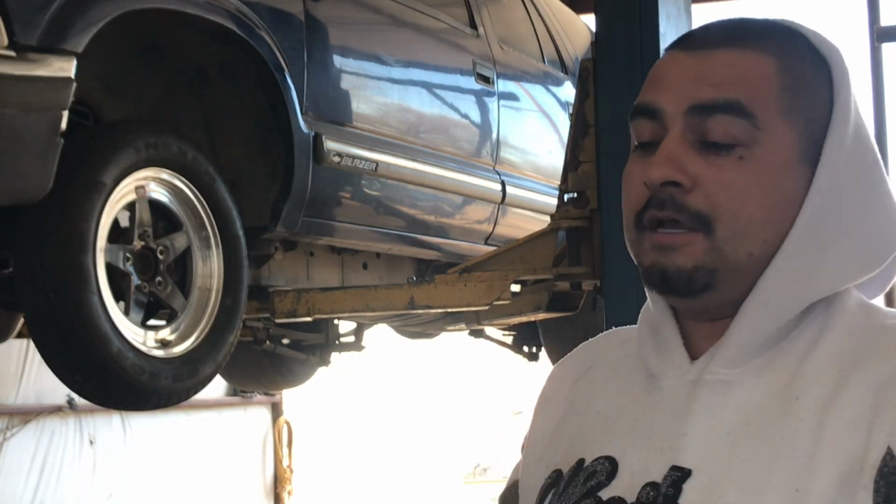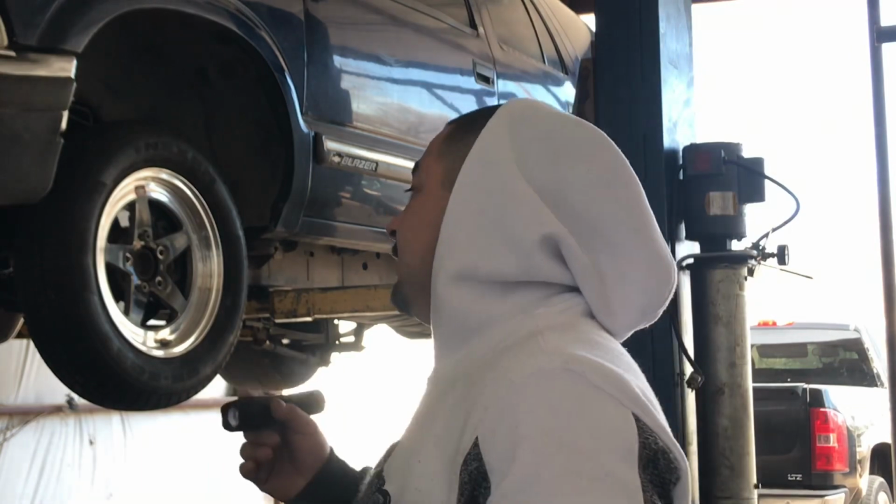So I really don't think that it was actually the head bolts. I actually think it was really the fuel, because last time I did that too, I blew it on 20 pounds. It ran good and everything. And the Mormons, they're my homies. You know what I'm saying? They come see me. Anyways, they wanted to go for a ride because I've been telling them it's fast, this and that, blah, blah, blah. They wanted to go for a ride, so I took them for a ride. And on 20 pounds of boost, I blew 2 head gaskets. Both, and I melted the head on one side.